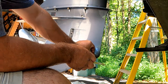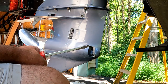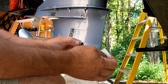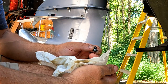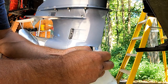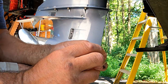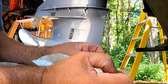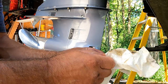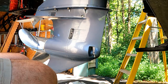We're not going to get much oil coming out yet because I haven't opened the top plug. We'll get a little bit of oil dripping out, but until we open this one up there's kind of a vacuum in there. This plug has a little magnet on the end — you want to make sure you wipe it off. We have the old washer on there, so you want to remove that and toss it. You need to replace these every time you take them off. Just make sure the plug's good and clean.